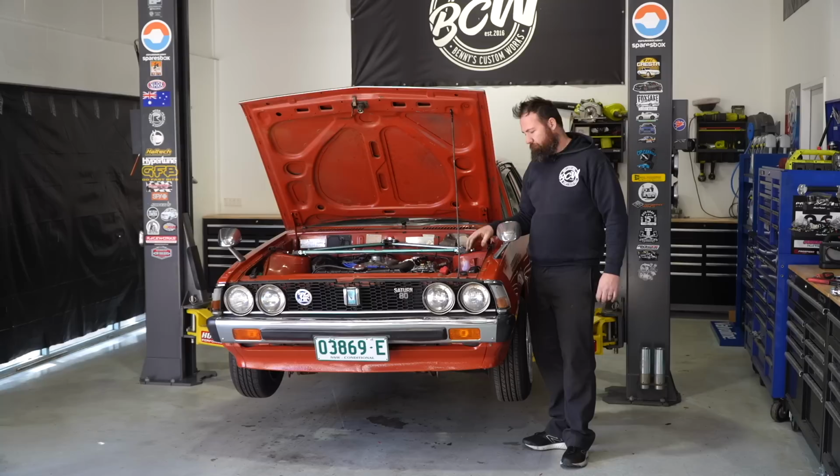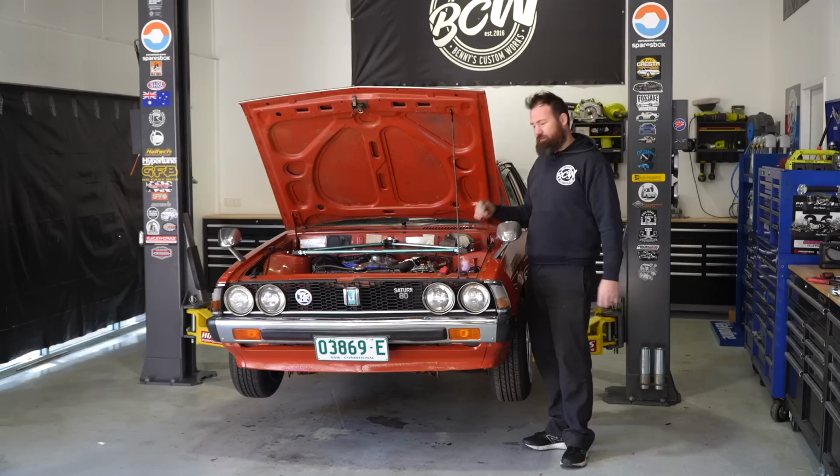We've got our battery and all of our cables sorted now in the bay, so we're going to go up and pull our wheels off, then take the axles out and change our diff center, and hopefully it all fits because the diff center is from Japan and the car is not.